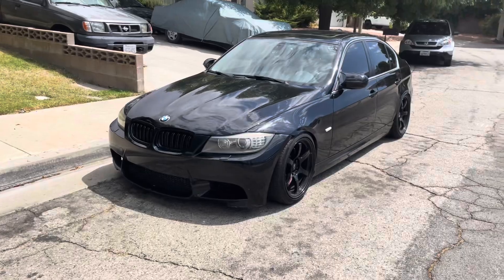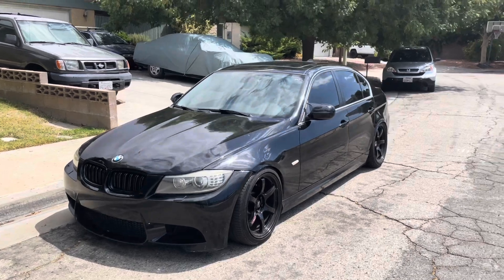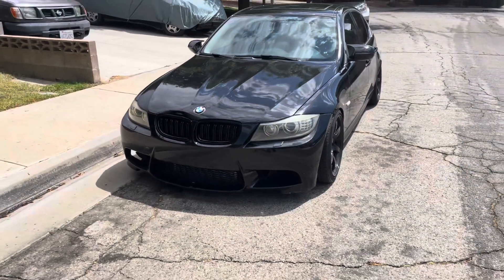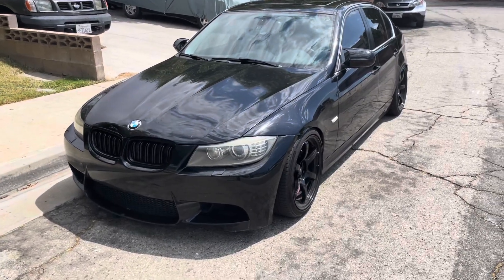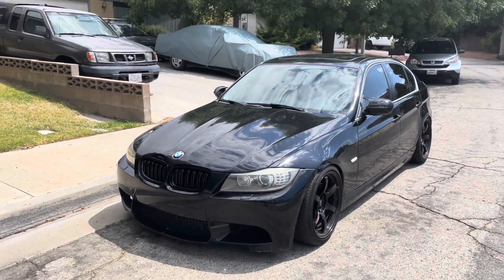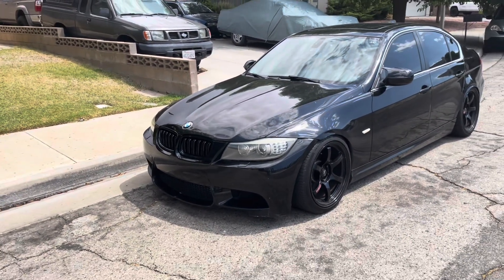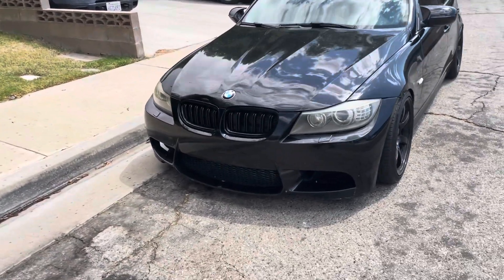I only paid about $40 for an intercooler, but the other factor is that N5x intercoolers are just a lot cheaper. For the diesels they're more expensive, so getting one for a 335i or any N5x will be cheaper and lets you retrofit it without dealing with the stupid green and black OEM seals. I came from N5x cars and much prefer silicone couplers with a t-bolt clamp — it just works, opposed to those seals that are just going to blow out. They're kind of a band-aid fix.